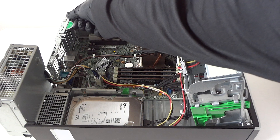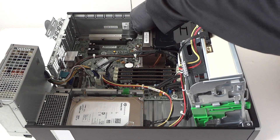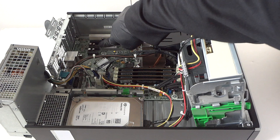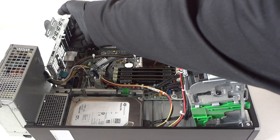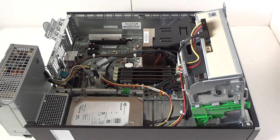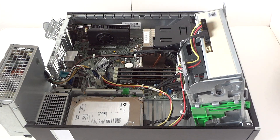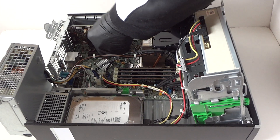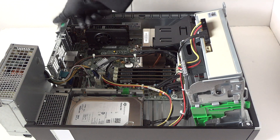There's a little clip right here — press it up like this to remove the bracket. We're gonna install through the PCI Express x16 slot — the black one. The two smaller slots are PCI Express x1 slots. We remove the low profile PCI bracket and install the video card into the PCI Express x16 slot. We just install the video card and secure the lock.